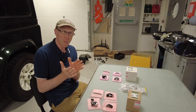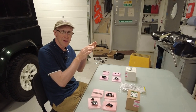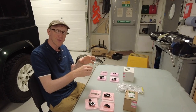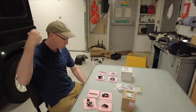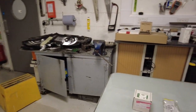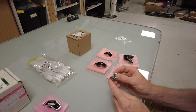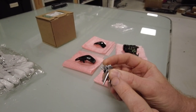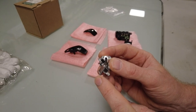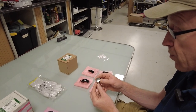Let's look at the options before we go in the car, because it'll make more sense here. Basically, the problem is this little prong on the end of the button breaks. When it's not touching the switch, it doesn't think you've pressed the button, so it won't select gear.